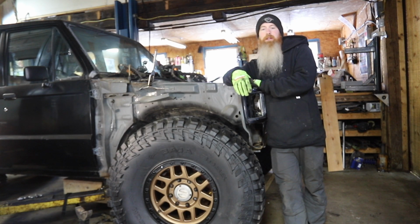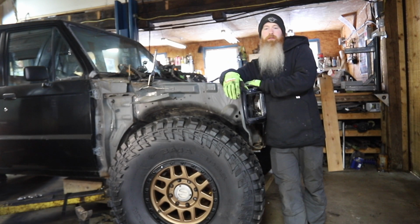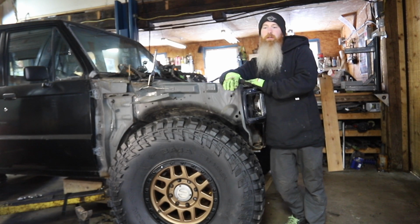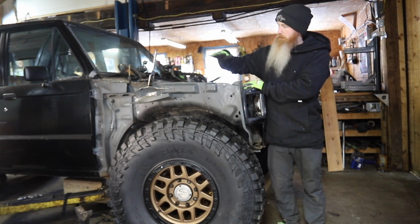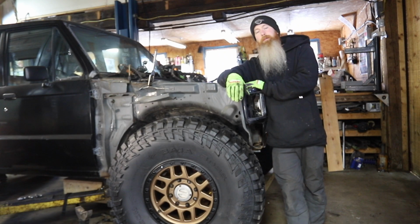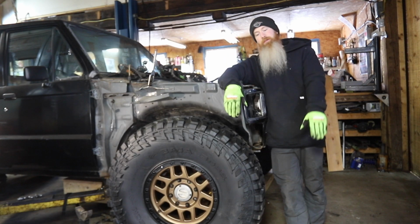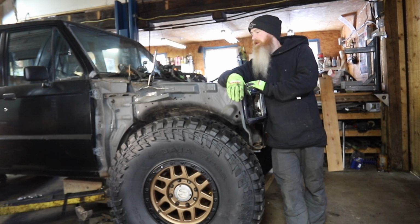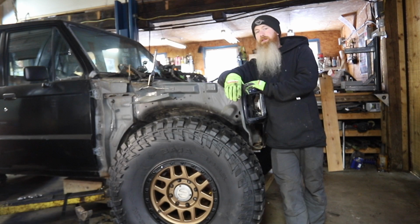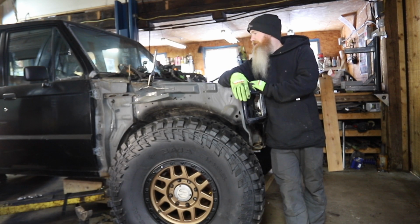The way I'm setting up the suspension on this is we're going to go up 7 inches from here, and that'll allow the 14-inch travel shocks to go 7 inches either direction from ride height. So at ride height, which is 7 inches higher, we will be able to hit a bump and have the suspension compress 7 inches, go off of a cliff, have the suspension drop 7 inches. So that's a lot of suspension travel. Most factory vehicles are not even half that. So we're gonna have a lot of motion in here. Just wanna make sure that we're able to control that and that it's not gonna smash into stuff if you go over a big enough bump. So this is our baseline.